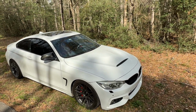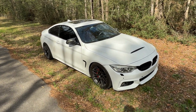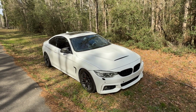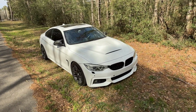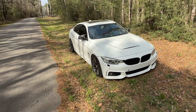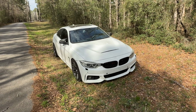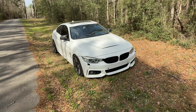And on the engine as well, I have a 3.5 bar map sensor. I do not need it with OTS. OTS does not reach, I think the threshold is 21.7 psi. You need that if you want to go over that. You need the resolution. The stock one cannot see over that. But I've had it just because. If you go custom tuned and your car is capable of fueling wise, I highly recommend it, because your tuner will push 22 to 24 psi. More than likely, it's about what they're going to push.